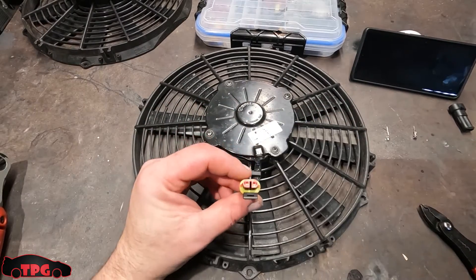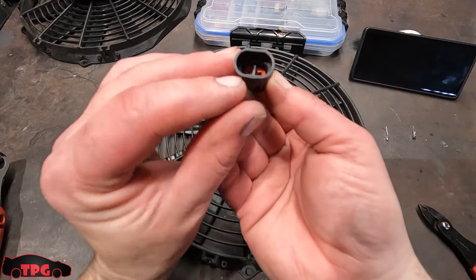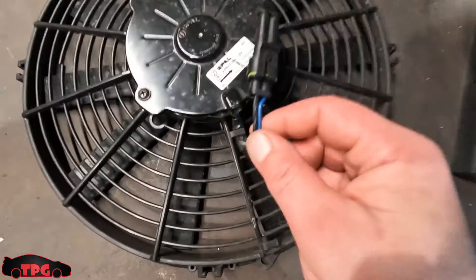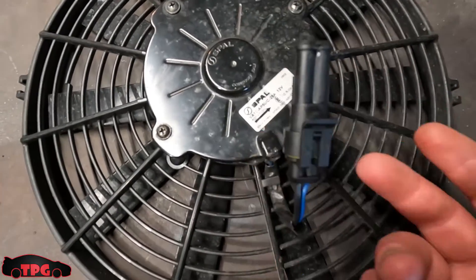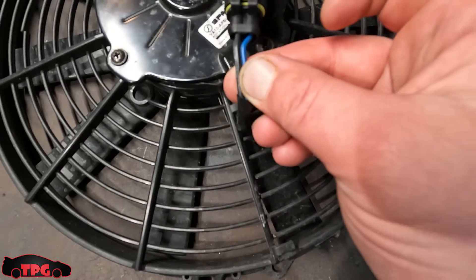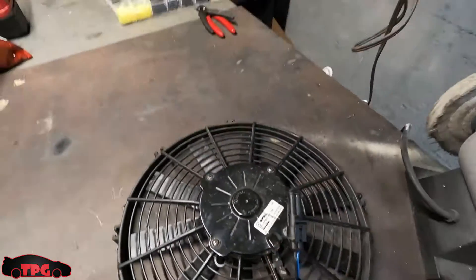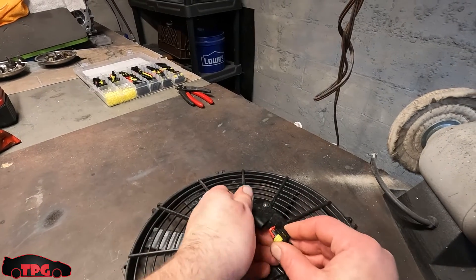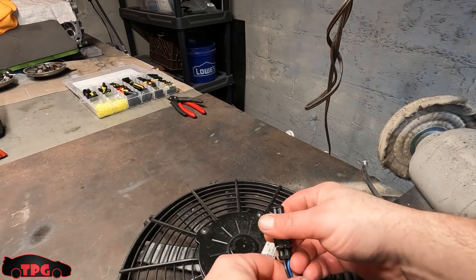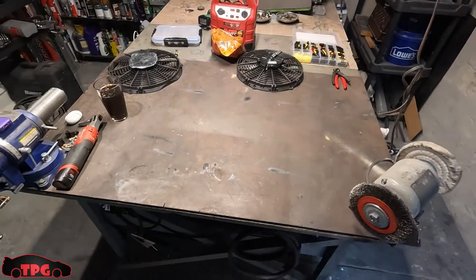Once she snaps, she's all set. The other side of the car uses the same process with the male plug — the wire slots in from that side so you can see the male pin sticking up on the inside of the red clip. If you have trouble getting the red connector to lock in because the wires are a little thicker than expected, you can buy different sized connectors for 14, 16, or 18 gauge. Just put the male connector over top and it'll squeeze itself in. Once you yank it out, the red clip should be nice and seated on the inside.